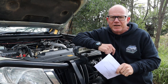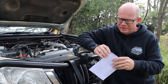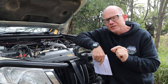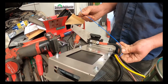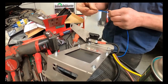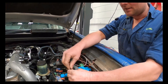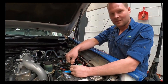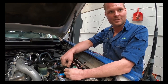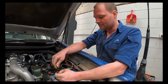Just a couple of things about installing the Redarc: there is a lead — I believe it's the blue one — called the ignition trigger wire. You need to connect it to the ignition. What we do is run this in the same conduit that goes up to the cranking battery, keep it all nice and neat, and take it off from there. With this particular type of alternator it is not mandatory to run that wire, and there'll be debate over this, but to ensure the charger charges at all times through all conditions, run that ignition wire — if the car is on, the charger is on.